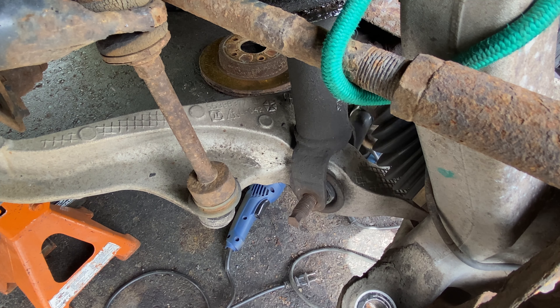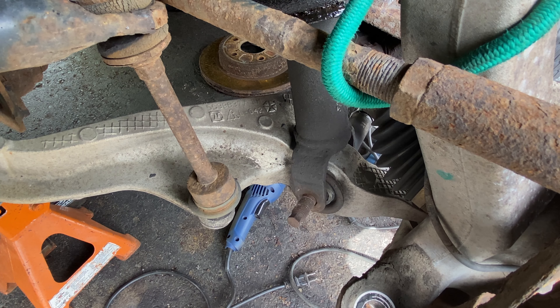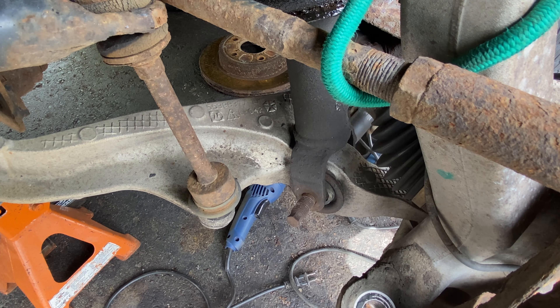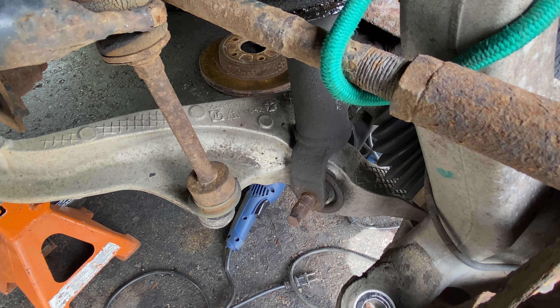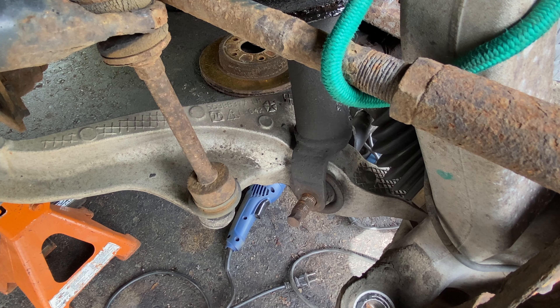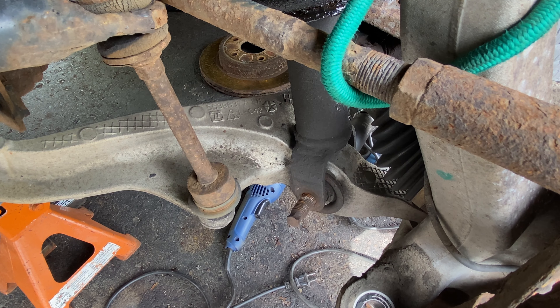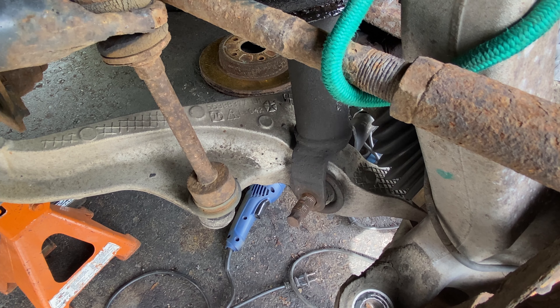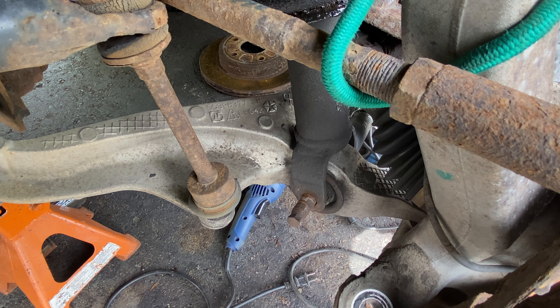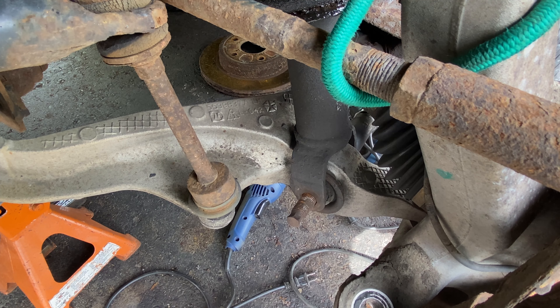That made a breaky sound. So all that's happened there is the rubber in the bushing has detached itself from the outer sleeve, but the inner sleeve is still fully attached and just turning within the rubber of the bushing. This is why I've got to try and cut this bolt off to get access to push the whole bushing out. I can't do that until this shock absorber is off at the bottom.